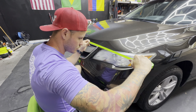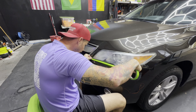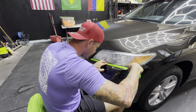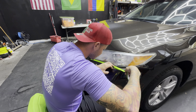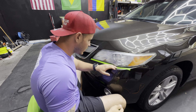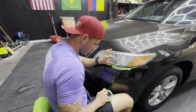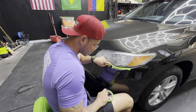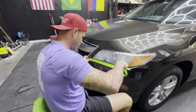Starting with the tape, pull it out and stretch it. Something I like to do is get underneath the light so you have nice coverage underneath with no gaps. This is automotive tape so it has a little flexibility to it — stretch and manipulate it around so that when you're polishing with your three-inch pad and you accidentally scuff the side, the tape is protecting. I like to run two strips towards the bottom end.